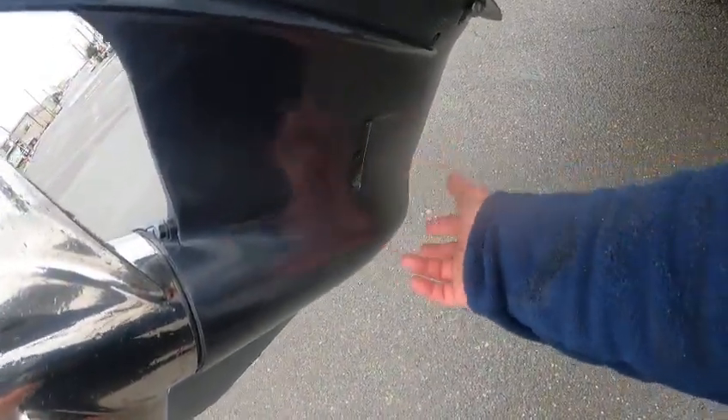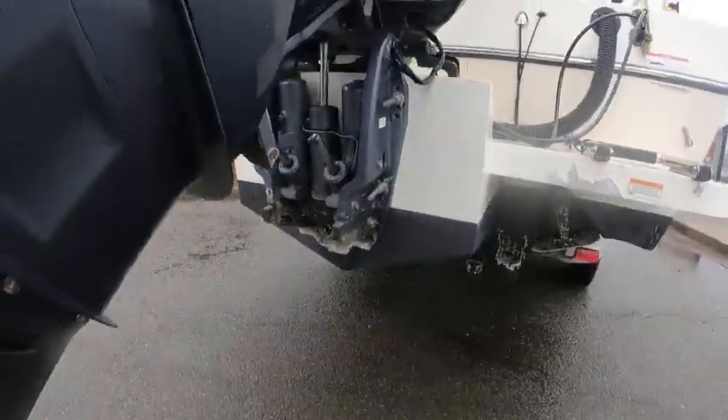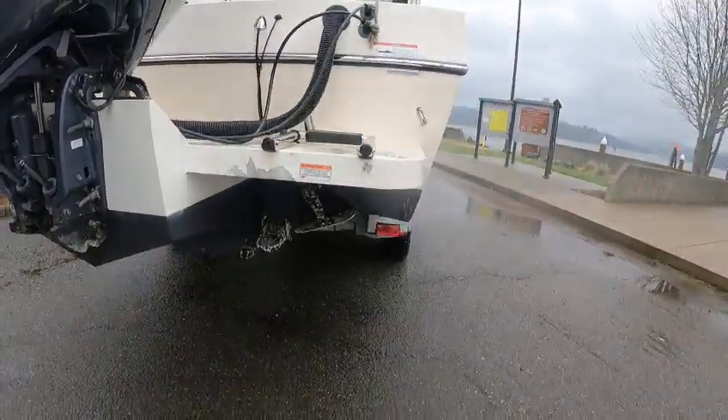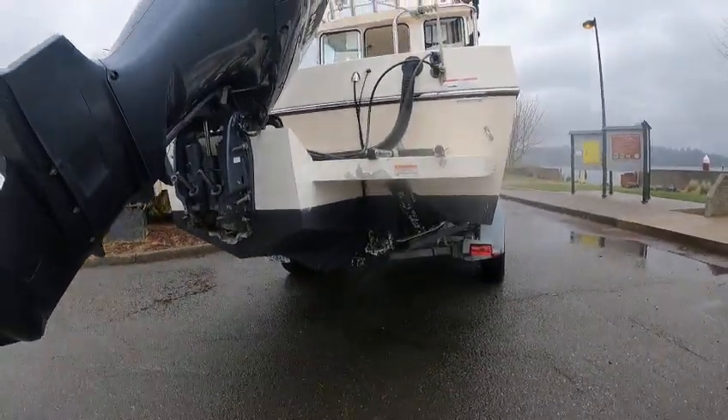This has got the pickup scoop here. If you don't have the bullet connector back here and just got the flushers, put the flushers on, tape that off to get your maximum water flow. That zinc bar needs to be replaced — barnacles on there, wouldn't hurt to get them off.